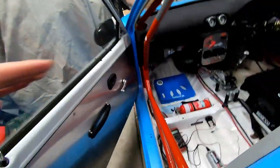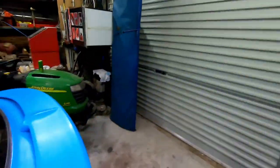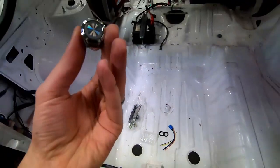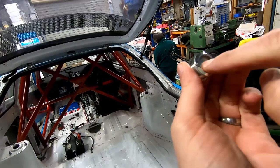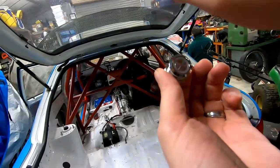So how are we gonna do all this? Let's pop the boot. So this is what I have to do every time — it's not a big deal, I just don't want to do it anymore. So with the tailgate open, it's actually gonna be a simple process. We're gonna replace that lock with this little guy. This is a waterproof stainless steel momentary push button. What momentary means is it's not like on and off — once you're holding it, it's on. When you let go, it's off.